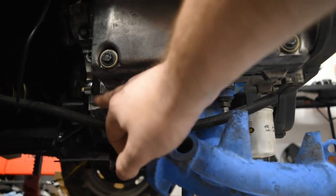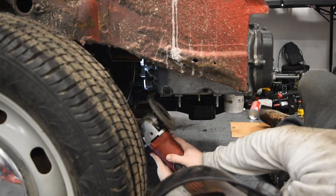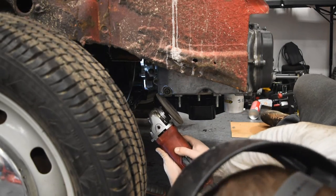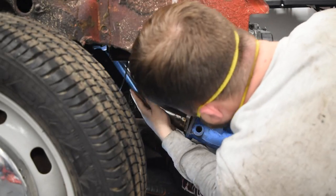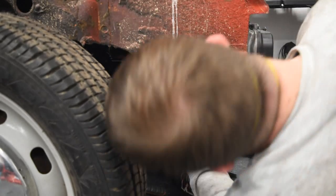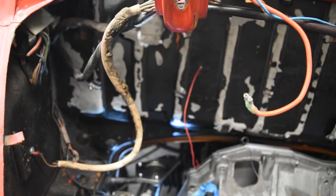I'm going to show you how, if you want to use a turbo up pipe with single overhead cam heads from Subaru, there's a small tab on the heads that actually needs to be ground down. It's this little piece right here — it needs to be ground down so that the up pipe won't hit it. So we got what we need to trim down here to get the clearance. It's very tight but there is clearance. The turbo would go here but it looks like we're going to have to do some more cutting — we'll get into that next.